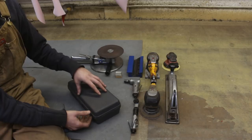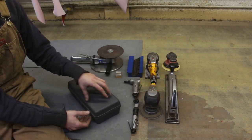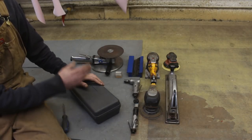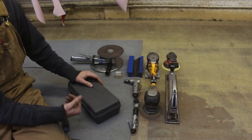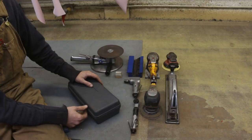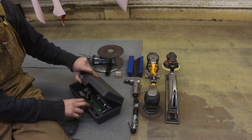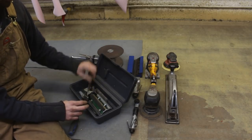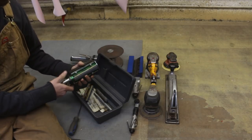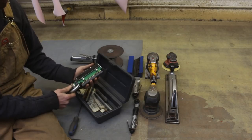And I'm sure it's not rebored to plus 10 and then it was worn to plus 17, because it would be out of round, it would be tapered, the size wouldn't be so consistent between the cylinders. So I need just 3 thou more for the cylinders to be bored out, and for that he assured me, I'm not familiar but I will try, he gave me this honing tool with which I can hone them and bring them to plus 20.